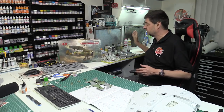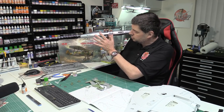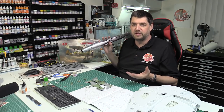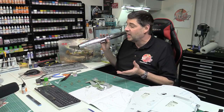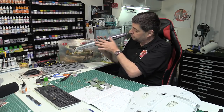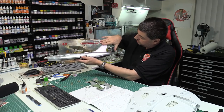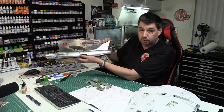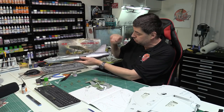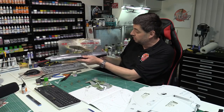I've been saying since before Christmas about having a play with it and testing it with Buster - yes, it definitely works, very nice, and a good solid color too. It covers very easily even though it was thinned more than 50/50 - probably more like a 60/40 mix, thinners over paint - and it just covered beautifully. This was all black under here and I sprayed that, then down here you can see the panel, and the entire tail. The tail was horrible - had a swap sticker in there for goodness sake - just chucked it down and it worked.